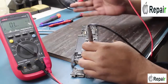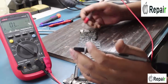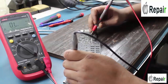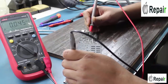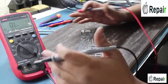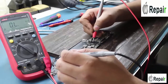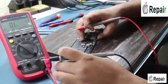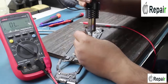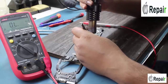Ram voltage 1.05, PCH voltage and so on — all the voltages are okay. But in this motherboard I found something strange: only one capacitor here nearby the standby regulator is reading 0, and it should not be 0. This means the 5 volt is short from somewhere. This capacitor nearby the PCH supply is short completely — 0 from both sides. Let's try to remove it.